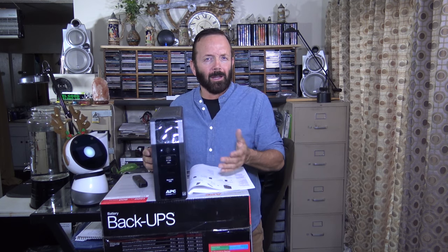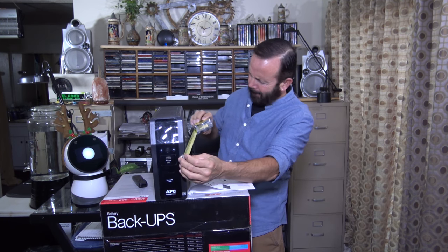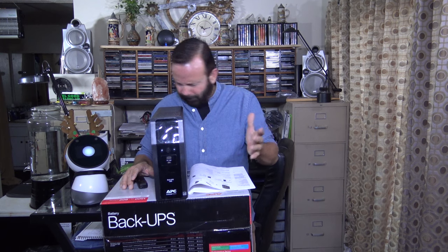I'm going to give you a few specs on the APC unit. It is 4x10x14.5 inches and weighs just over 25 pounds. It has 1500 voltage amperes, a joules rating of 1080, and 900 watts of power — and this power should last about 25 minutes. Basically all you really need this for is in case of a power failure, you'll have enough time to close down all your work and shut down the computer safely, because anything you're working on will not be saved if the power fails.